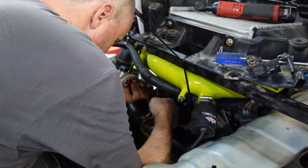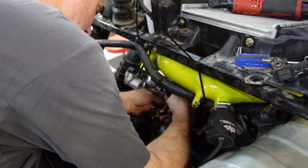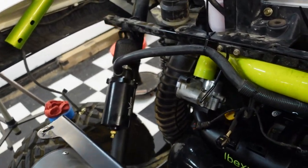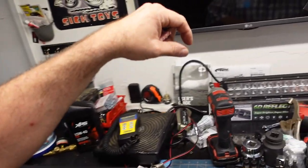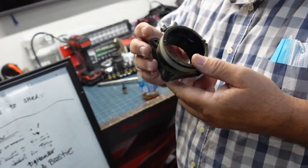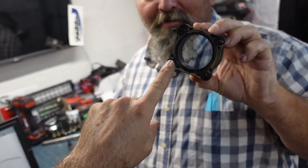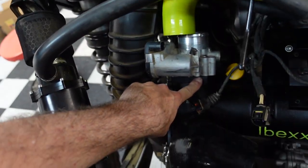Here's the current situation. As soon as Danny's right here, I'll show you. What we're looking at is this guy — and that guy that Rob's holding, see that? That's got to come off because it doesn't fit anymore since the intake doesn't have a round connection. Round hole and a square peg — not working. The intake comes with its own square connection, and that's where the throttle body goes.